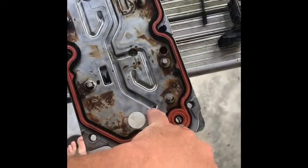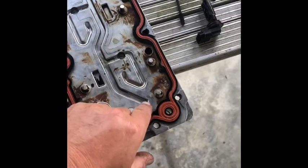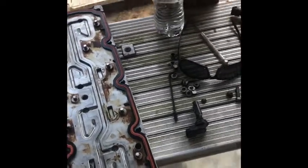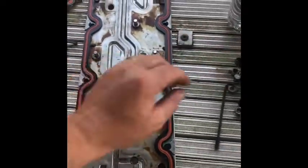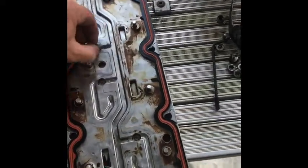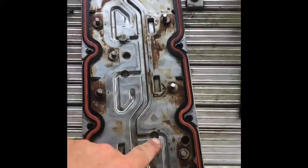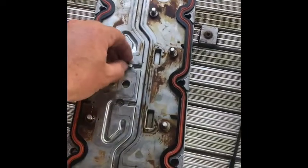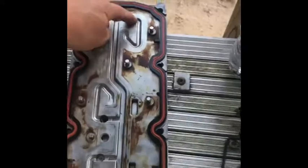I'm going to put a really good sealant on it, and once I do that I'm going to stake it right here with a chisel so this screw cannot come back out — because obviously if anything falls off of this it will end up in your engine where it does not need to be. Once you remove the solenoids, there are little things in these holes — they look like flow regulators or something. There's one in every one of these holes, and if you don't remove those they will fall out when you put this cover back on and end up in your engine. So I got those out.